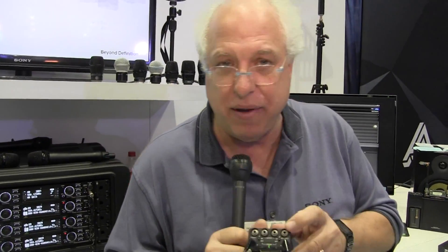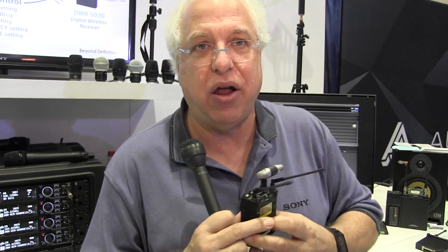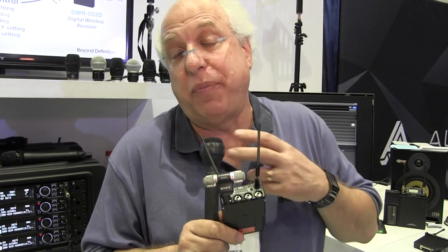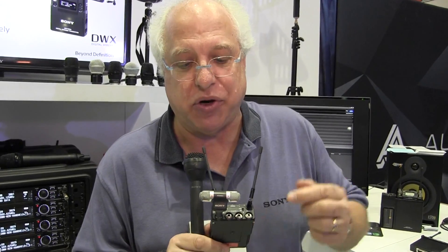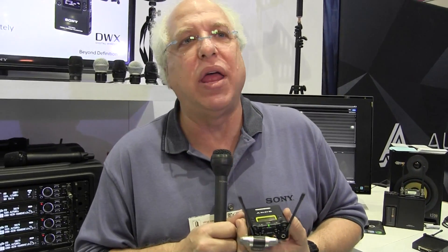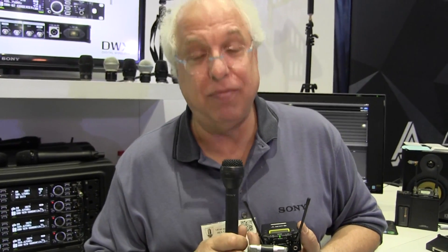That little microphone input is also a stereo jack. So we could take a plug-in power stereo microphone, assign that hard left and right, take my up to two on-screen talent, map them down the middle so they come out of the center of the TV, but capture stereo ambience of wherever we are — in the middle of a sporting event, in a church listening to the pipe organ reverberating, a classroom — it's so important to be able to hear the audience laughing in response to the people wearing the lavaliers.